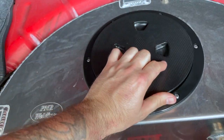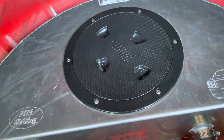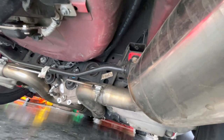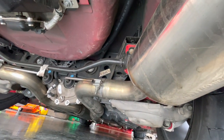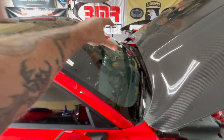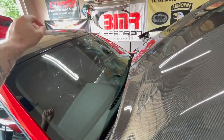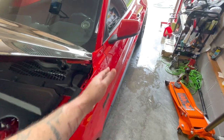The tank is about 80% full, so I could pack it full of ice right now and make some hits at a local track. A lot of guys think they don't have enough flow - my advice is to check your wiring, because something's off. Make sure you have a good power and ground. Our feed and return come out of the side and run together, going up over the independent rear suspension. There is room to do that without pinching anything. The feed runs across the car underneath, alongside the long plastic shield that covers the fuel lines.